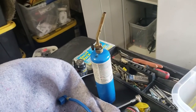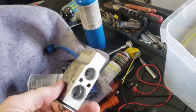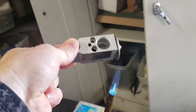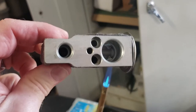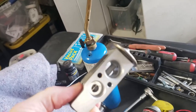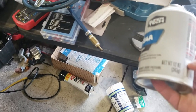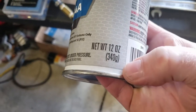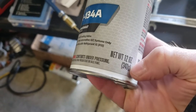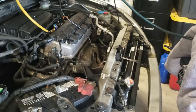I'm going to blow through it — it's somewhat restricted but not totally. I'm going to try to heat it up now and see if there's a difference. Yeah, it definitely opened up. It appears that the old H-valve or expansion valve was working, so I don't know — maybe it just wasn't working well enough. I do know that the system calls for about 500 grams of refrigerant and this can is 340 grams. I've already put in like half a can of refrigerant so I believe it needs another can. I'm going to put in a can and go from there and see how it works.